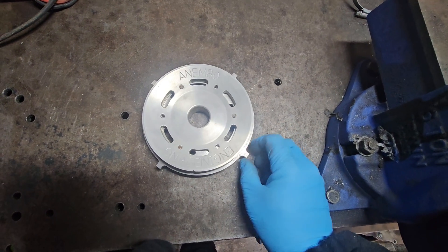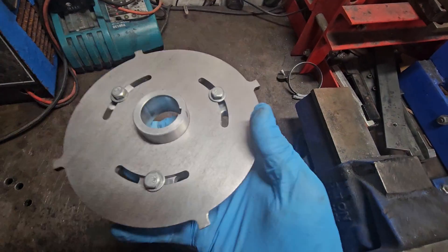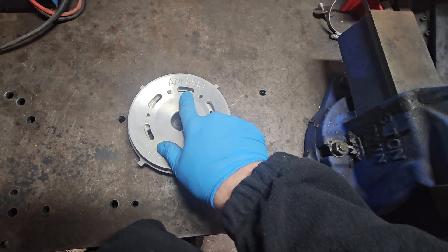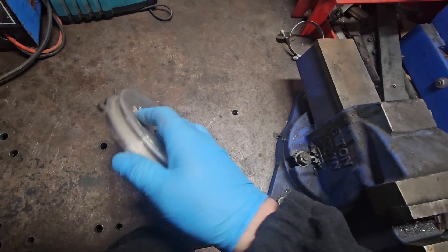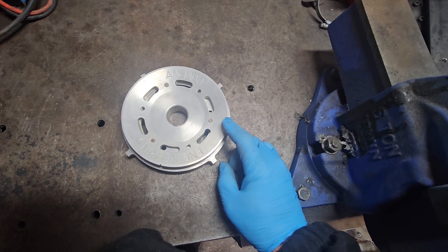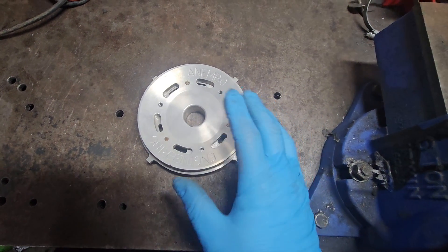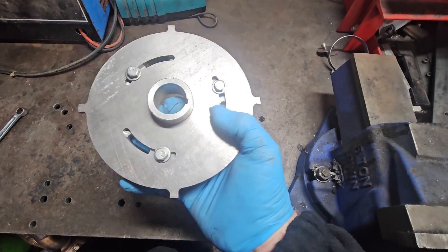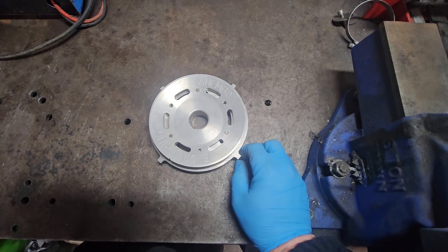Okay, that's the bottom pulley removed. We can actually see that this is loose as well, so I'm really pleased we had to pull that off because that could have set us up with some potential dramas in the future. This company used to be about loads back in the good old days — I've Googled them and they still seem to be about, but they don't stock different types of these anymore. Most people doing CVH EFI stuff will use a flywheel, which is kind of readily available. However, this is the natural progression for this conversion, since it's already got these bits on here and it's a really nice piece of engineering. All we need to do is draw this up with a better positioning tooth wheel and bolt that to the back.